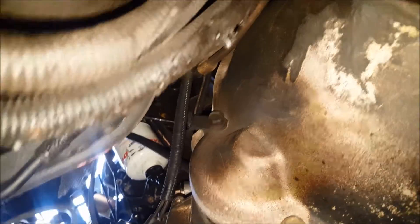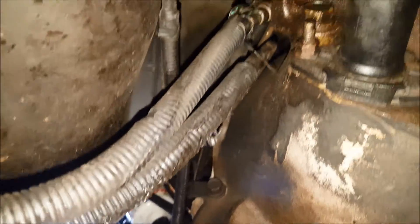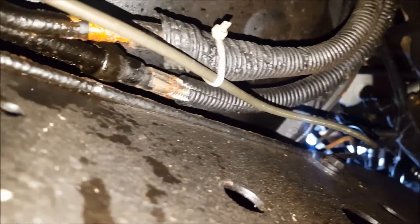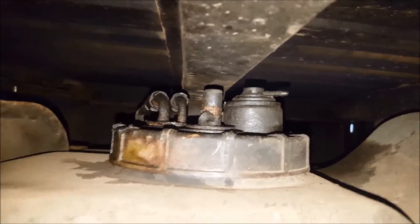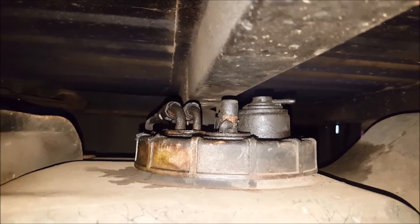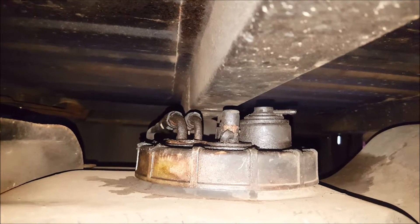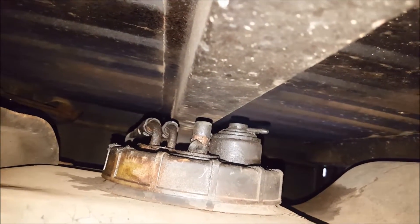It could be any one of those connections up top, and then coming down your fuel supply line — the fat line — could be this connection here, could be a rusted out line. Typically with those, you're going to see fuel leaking out of them, and when you go to start your truck after sitting for a week or two, it's not going to start right away. This thing always starts immediately, so my air leak is pretty minimal — but enough to bounce the gauge and get air in there. Tracing those lines back, they enter the tank up here. Any pinholes or bad O-rings on the fuel outlet could allow air in. Also, you could have an internal leak where that pipe dips into the tank if it's rotted out — you won't see any external leaks at all, and it could definitely be allowing air to enter the system.